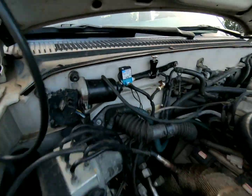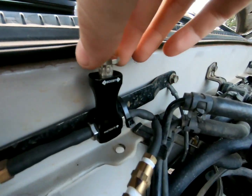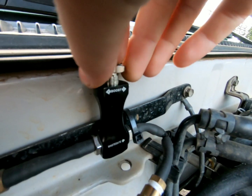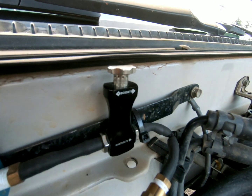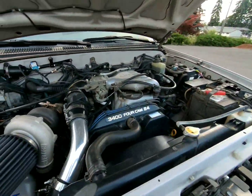I'm gonna find a place to turn in here and turn down the boost controller a little bit, because I was not flooring it, by the way. So we were seeing 14 psi at maybe half to three-quarter throttle. Yeah, so we're gonna turn it down, make a few more hits, see what happens. Alright, so let's see here. I'm gonna say that way's down. So I don't know. Let's see what that does.